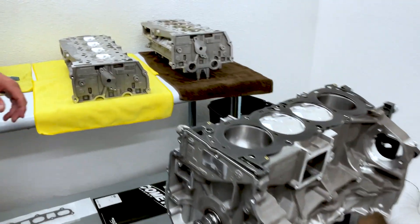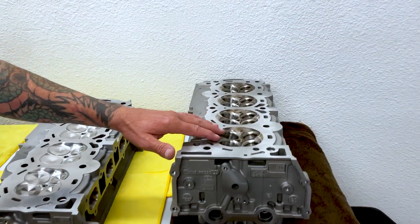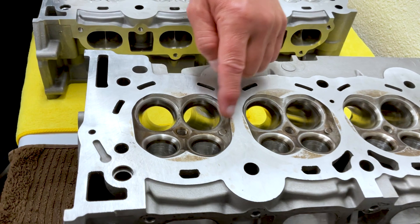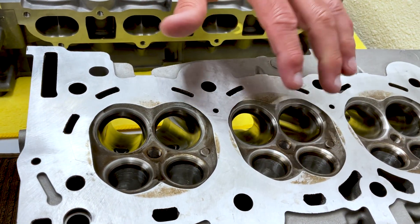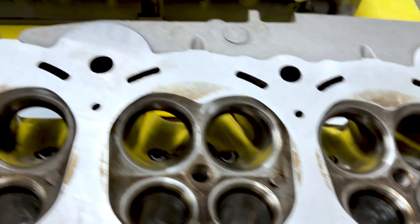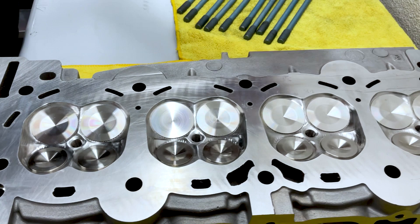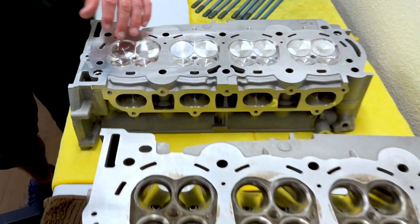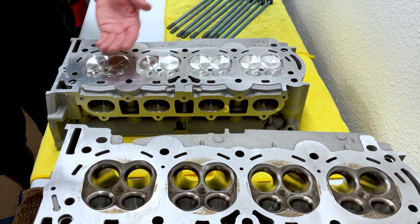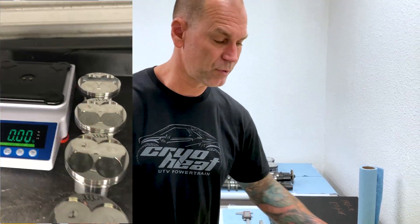Come real close — I'll show you a little bit about the head. This is a stock head that's just had some mild porting done to it, and this is the actual pocket right here. You can see how it is stock. Just the actual pocket of the head, and then you can see our head where we've CNC profiled it and then went ahead and chased it, getting rid of all the hot spots and high risers. I CC the volume of the head to make sure they're all equal, trying to get this monster to flow and run absolutely perfect.